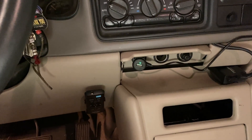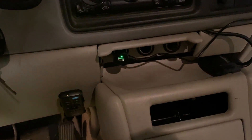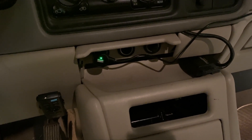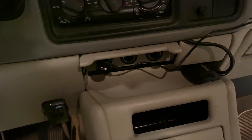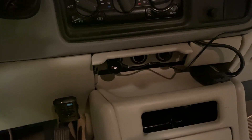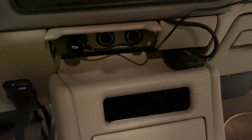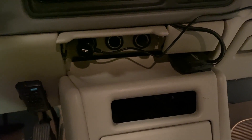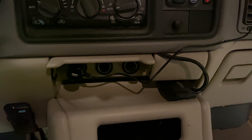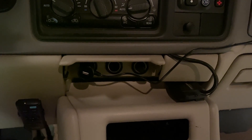I forgot to show you the best part. I'm thinking about something other than driving — thinking about what I'm going to have for a meal — I'm not thinking about the Wolfbox and I shut the truck off and hop out and go in the house, and what happened? The Wolfbox turned off. So all of your outlets will now be operated by the key. No more leaving devices on in your accessory outlet and having your battery run down. I hope yours went as smooth as mine. Remember to disconnect the power coming from the fuse box. See you. Good luck.